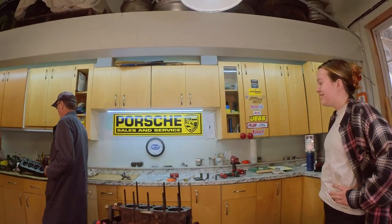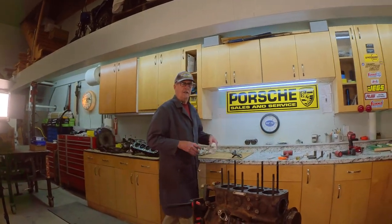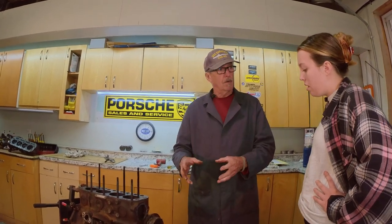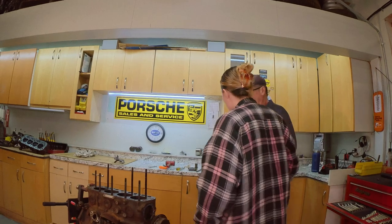Yeah, but you know, that fit tight. Even when we were trying to move it by hand, we actually had to take a hammer and hit it to make it turn. But yet it would do it on its own with the vibration at 7,000 RPM, because it retarded the timing, and we almost cut the motor in. Yeah, it's been fixed.